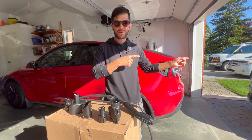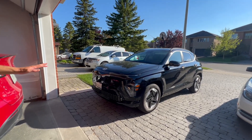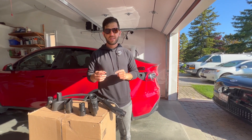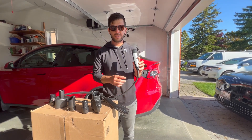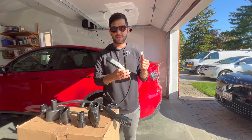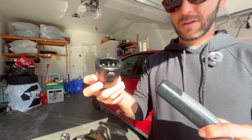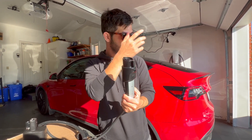Now let's move on to our CCS Hyundai over here. This is a 2025 Hyundai Kona Electric. This one still comes with a CCS port. Some other Hyundais are actually going to be coming with the NACS port this year, which will make charging at a Supercharger station a lot easier. So let's talk about level 2 slow charging for the Hyundai. There are still a lot of destination chargers at hotels that use the NACS port, or home charging stations like the Tesla charging station I have behind me. So with an adapter like this one — it has a NACS input and a J1772 output — I can just plug this in, and then this Tesla level 2 home charger becomes a J1772 charger compatible with the Hyundai.